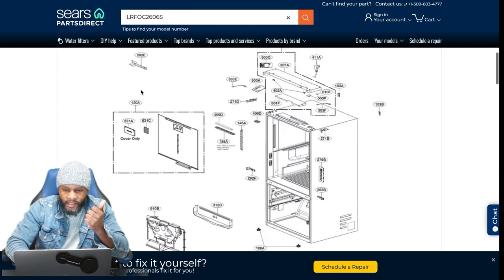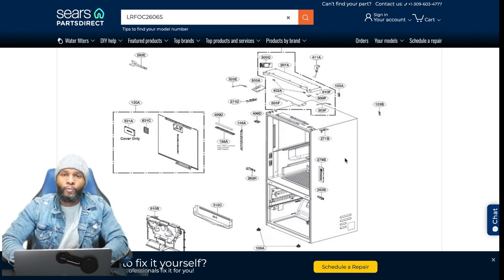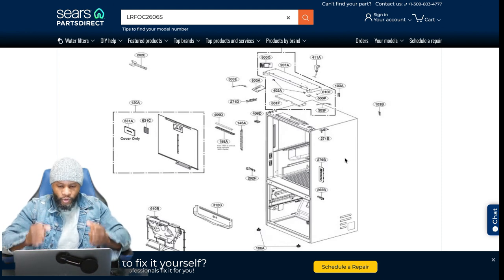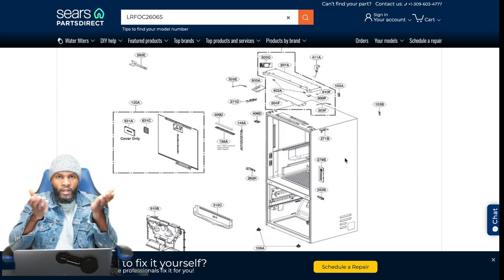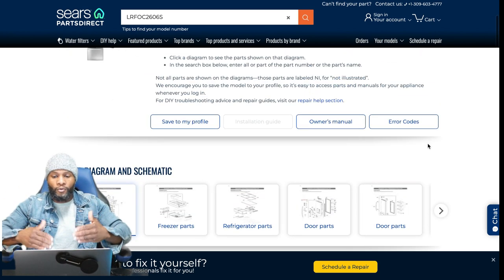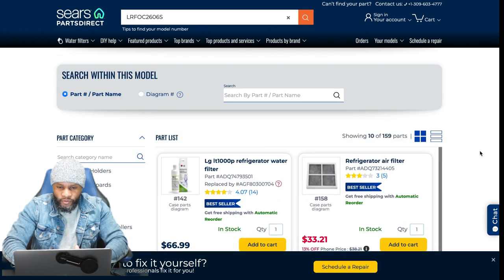You got the legs at the bottom here, and you can use this tool here to adjust the legs, to raise them up, to raise them down. You can also put the stopper on the refrigerator to stop it from moving. So you put those down and it's permanent. So in order to move the refrigerator, you have to raise the stoppers back up so that you can roll the refrigerator on the wheels. All right, so that's something to think about when you want to move your refrigerator.